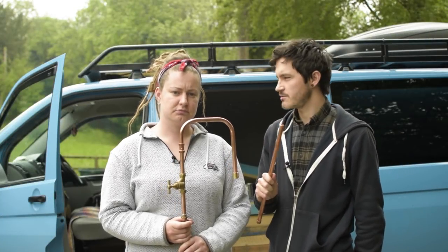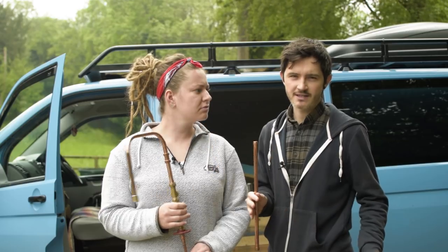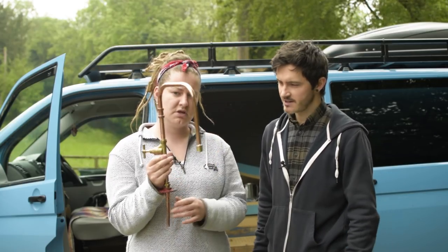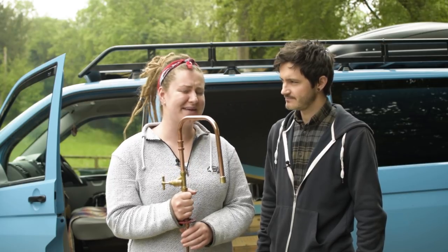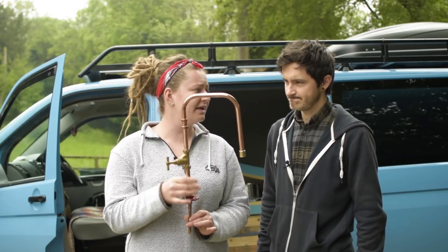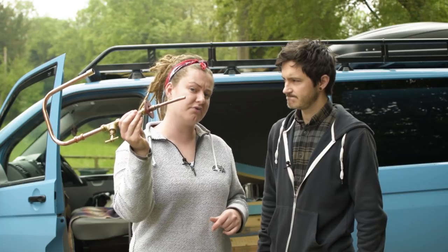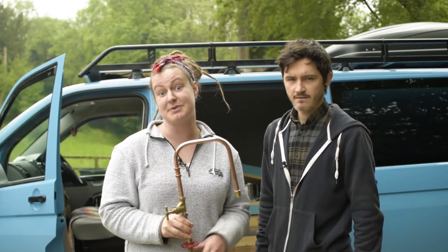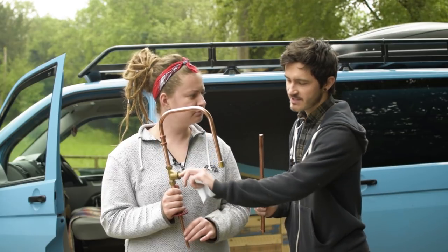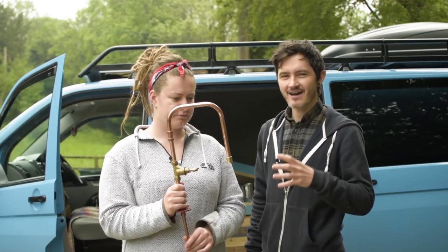One of the hardest things we've found whilst doing this build is to get nice 12 volt switches and also a nice campervan tap. We're all quite new to this so we didn't really understand how the water system works, but now we've worked it out we realise we can get away with a standard sort of tap design. All of the ones on the internet were very tatty plastic and we wanted something rustic to go with our theme, so we found this — handmade on eBay, slightly different to what was advertised, with the right size connector. Motorhome and caravan taps usually have a micro switch which tells the pump to turn on, but because this is just a traditional tap design we have gone for a pressure switch, so this tap itself doesn't have any electricals in it at all.